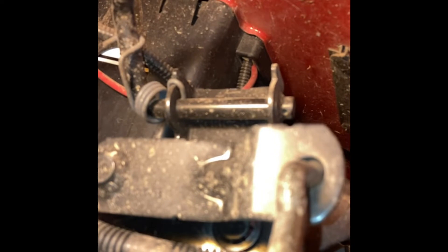So I've traced it down. It looks like the situation is this control arm linkage here. You can see when I move the lever forward, it does that — but it looks like there's supposed to be a cotter pin in there to hold this rod in place, to keep it from moving back and forth, because that's what actually activates the transmission down here. I'm going to try putting a cotter pin in there and see what happens. I also noticed the return angle lever seems to be missing a pin as well, so I'm going to try and put a couple pins in there, see if that helps.